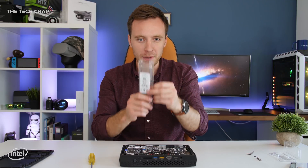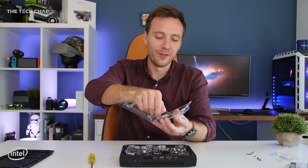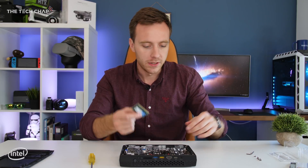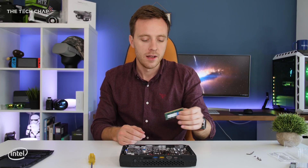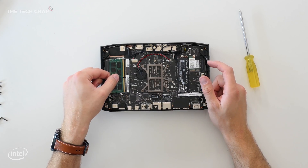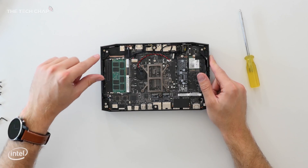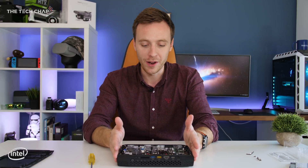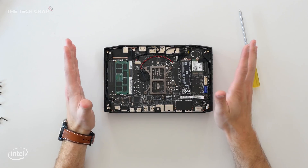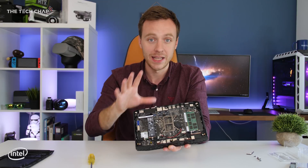Second thing is the RAM. Ideally you should use two sticks of RAM so you get dual-channel RAM, which gives you the most optimum performance. Intel kindly provided me with a single 16GB stick, so maybe I'll buy another set of 16 since you can get two RAM modules in here. For now I've got one DIMM module of 16GB RAM, which I'm just going to slot in there and push down until it clicks. That's it — we have set up a bare bones kit PC, and as you can see, that was super simple. If you're not sure what components to use, I'll put links in the description below for these exact ones so you can have the same setup as me.